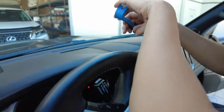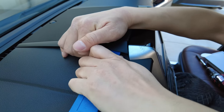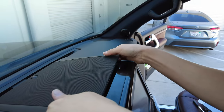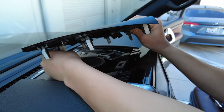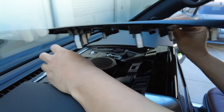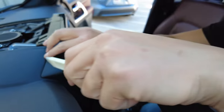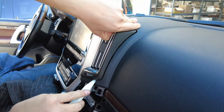Next step we're going to do is remove this top piece here. Grab a panel removal tool, pry it under here and just bring it out — it's just held by clips. Go for both sides. Then press down on the release tab and pull out. This is the sensor for your lights. Next we're going to remove these two side vents — use a smaller panel removal tool to assist you. We'll do it for the other side as well.